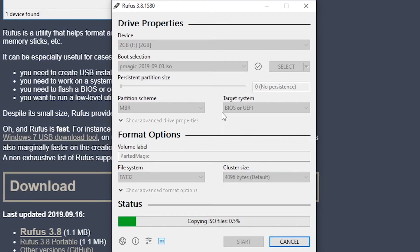Once this is finished, we'll be switching over to my laptop as I'm going to connect it up there and show you the process. We just need to boot from this external drive rather than booting from the OS. The next step will be different for every machine. Usually you can boot from another drive by pressing F12. If not, you can go into the BIOS and set the USB drive as the first boot device. I'd suggest checking your motherboard manufacturer's website if you struggle getting it to boot from the USB. So once this is complete, I'll plug in the USB carrier and we'll continue on camera.